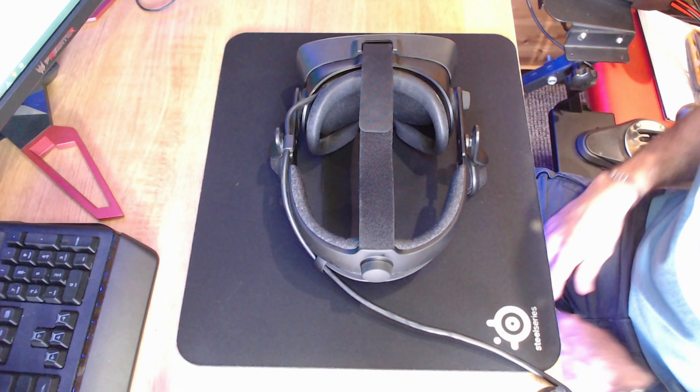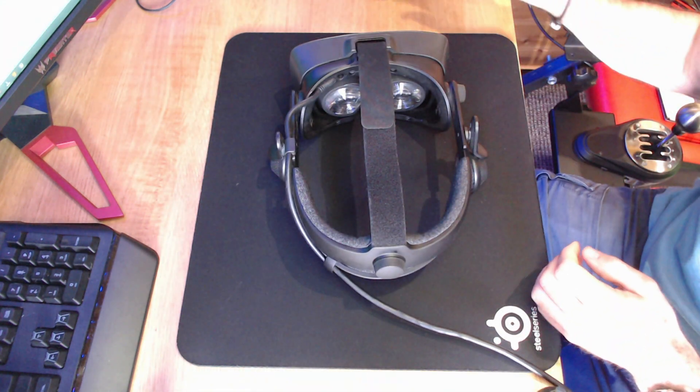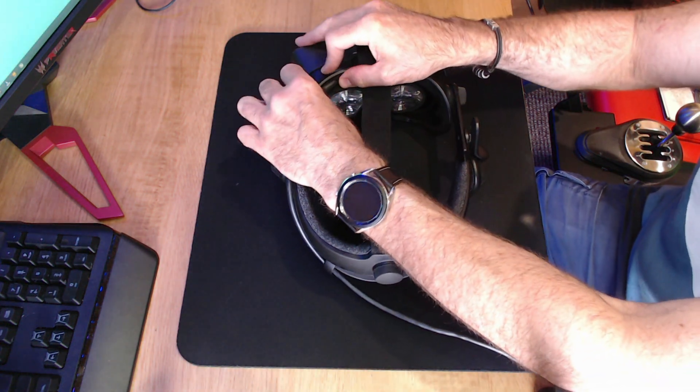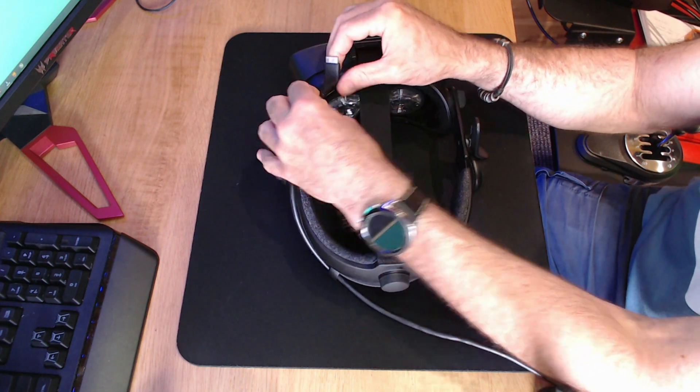So the king is dead. Long live the new king. Installation of the new cable is a doddle. Remove the facial interface, unplug the cable, then this little mount pops up and lastly gently pry the black plastic clip off — and voila! The cable is free, so just reverse what you did to install the new one.